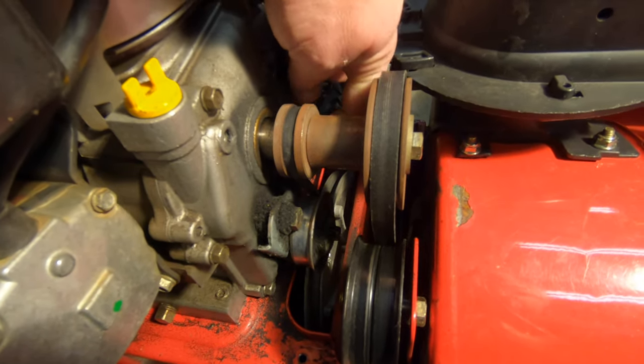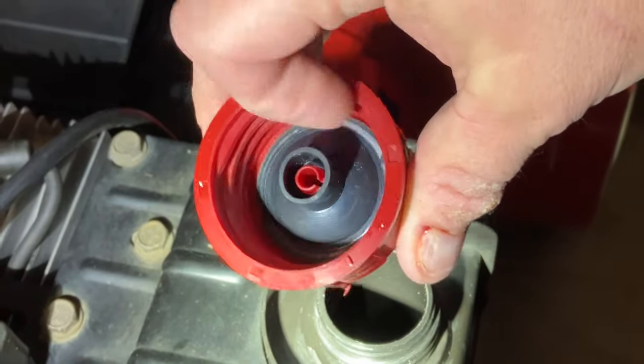I just wanted to get this done — we got some heavy snow overnight, not blizzard but enough that I've got to get it cleared up and it's kind of heavy wet snow. I've made previous videos about the belts, I've replaced the shave plates and shoes. I still feel like there are some tension springs I can try to work with — I've never replaced those, and they may be getting to the point where I need to. In this case though, I think it is the engine's carburetor — it was starving of fuel. Also, that fuel cap has to let some air in; it may have compressed at the top. The engine ran fine except under load, and that's when it would stall out. This time I think it's got more power, it's shooting better.